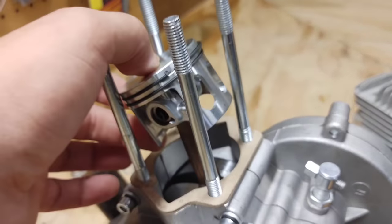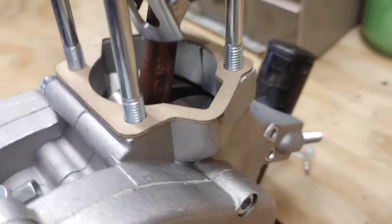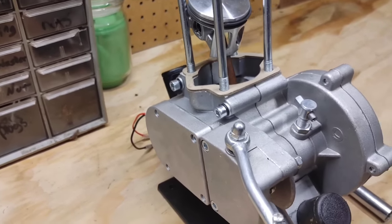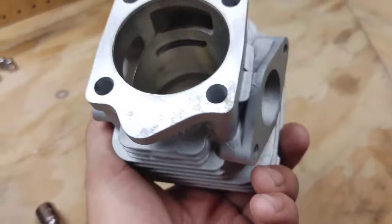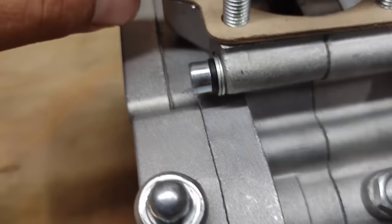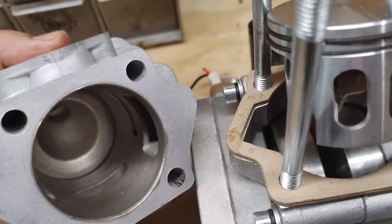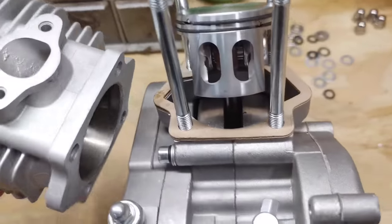So they told me there's actually a special ceramic coating on the inside here that keeps it protected — a little bit stronger than your other style China dolls. Let's take a closer look at that gigantic 52mm windowed piston, which works well with that reed valve. I do want to point out that this connecting rod is stamped YD-100. It has the same stud spacing as a YD-100. So they took a YD-100 bottom end and then put an MS-460 or MS-660 chainsaw jug on the top. The transfer ports here are open on the jug, but not on the bottom end, so you do have that space — not sure if there's any room for improvement there, but we'll give that a shot.